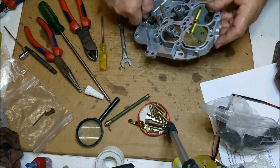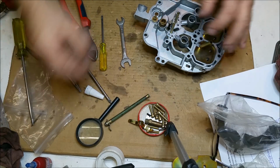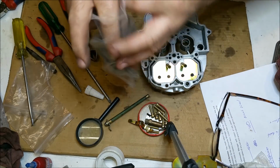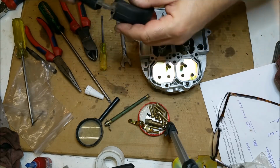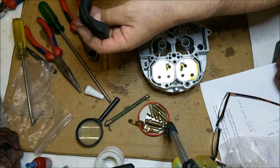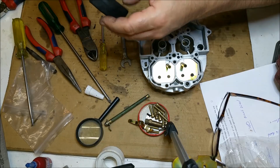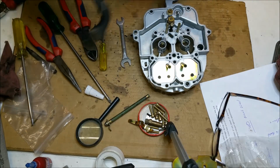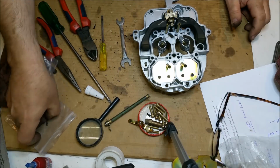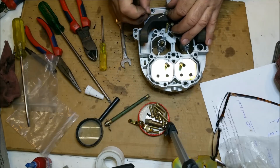And we'll put that little guy in. Right. Now, the floaties on these things are very, very easy to break. There's an issue with them in that when you bend them, they snap. People try and bend them with the float, you can't do that. Although this one looks a little bit on the munted side. I don't know that that float's too good actually. I would put a float in it. I would definitely put new floats in this. So it'll need a few parts, but it's a good basis for an excellent build.